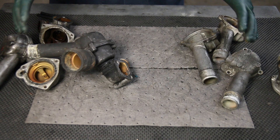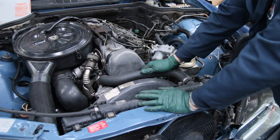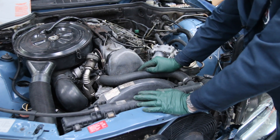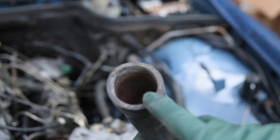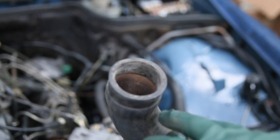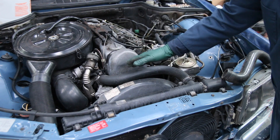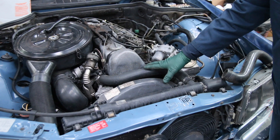It's really important to take care of your cooling system on these older cars. If you pick up an older car and aren't sure about the cooling system condition, here's a quick test: the coolant might look okay if it's been recently changed, but the real test is to get inside the radiator hoses. Pull the top radiator hose and look inside — if you see rust inside the hose, you've got a problem. The hoses should show maybe a little staining but should not be rusty. If you see rusty hoses, expect corrosion on the aluminum parts, potential leaks at all the clamps, and you'll need to flush the engine and probably replace most of the hoses.